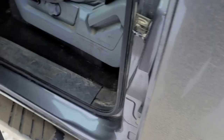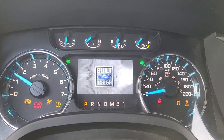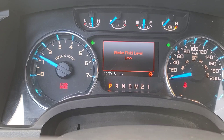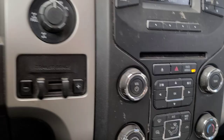We're back working on this 2013 F-150 XLT. It was here a couple weeks ago and we put a BCM in it and programmed it, and it's back doing exactly the same thing as it was doing before. You can see the hazards are on. Let's start it up. Driver's door ajar, passenger door ajar, left rear door ajar, right rear door ajar, low brake fluid. In reverse: check park aid. It sometimes says that the parking brake is on, brake warning light is on, low brake fluid message will come up, hazards won't shut off.